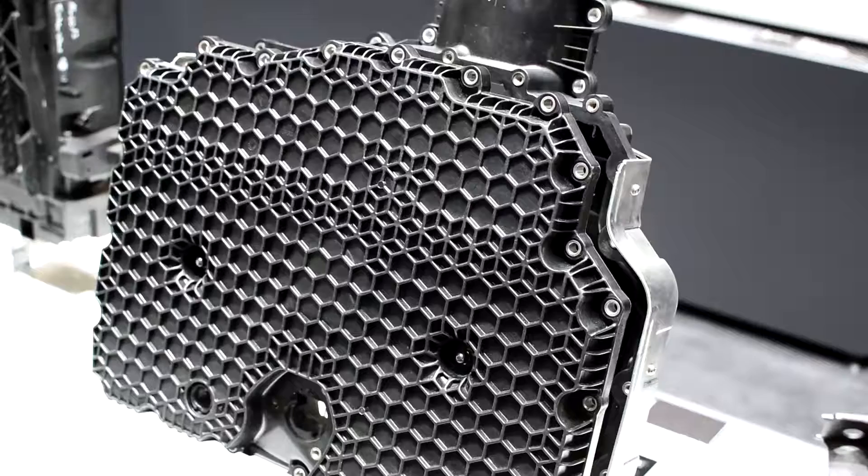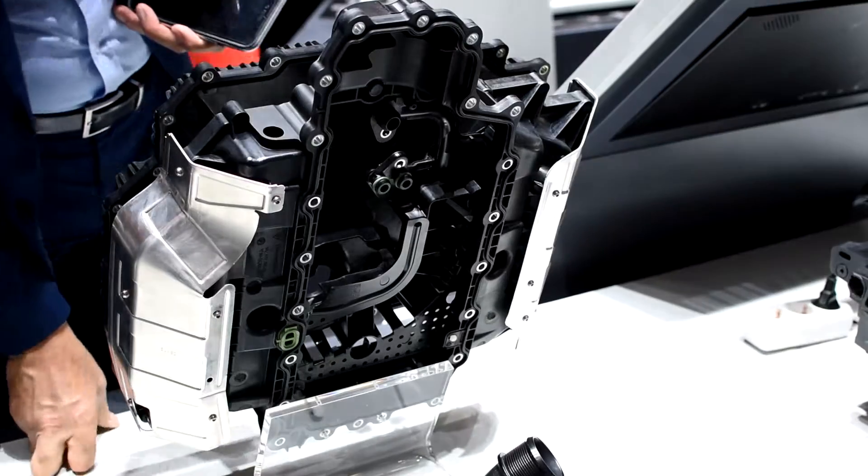This is also a very nice innovation — the driving force was again weight and cost saving. It's an oil pan for the Porsche Carrera. The former oil pans were made of aluminum, and at that time we introduced an oil pan with standard polyamide 6. We as Lanxess are pioneers in using polyamide 6. Other oil pans made of polymeric material use polyamide 6-6, so changing from polyamide 6-6 to polyamide 6 gives you saving potential just from the selection of the material.